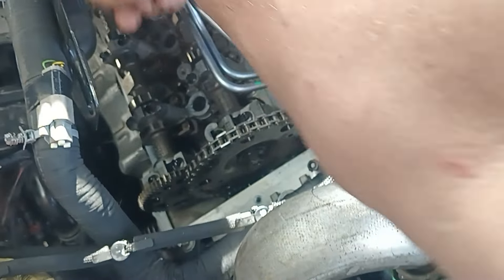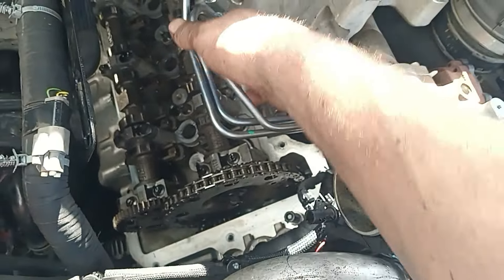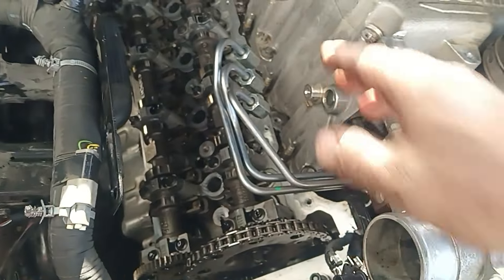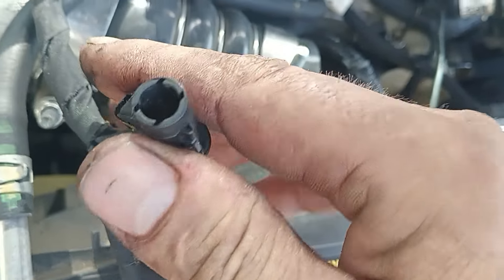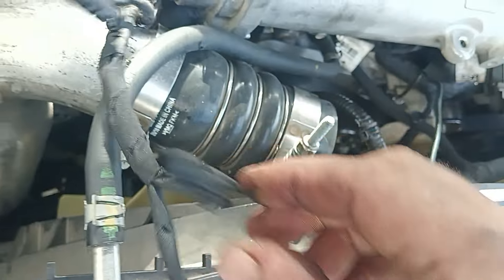You need to take all the bolts out from there — all the bolts in the center. Your injector rail: you have to take all your lines off. Take a picture of how the lines go. The glow plug wire just pulls out — it's not really a big deal. You've got to get some good firm grip on it and it pops right off.